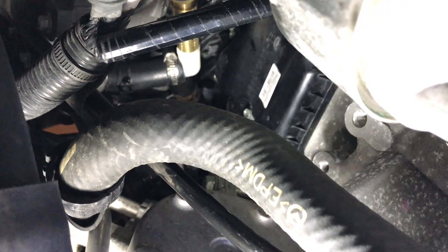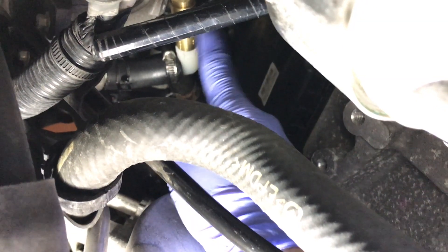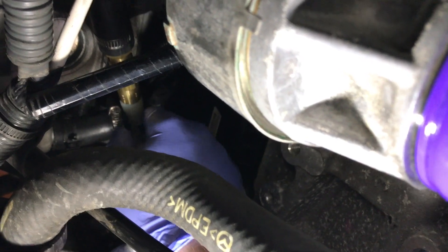Okay, the hoses are attached. The one with the check valve was attached to the intake manifold here, and then the other one without — that's just the hose — was attached to the PCV valve up there, a little hard to see. They were clamped. Now it's time to actually connect them. I routed the hoses up and over, right here, and the catch can will be mounted right there.